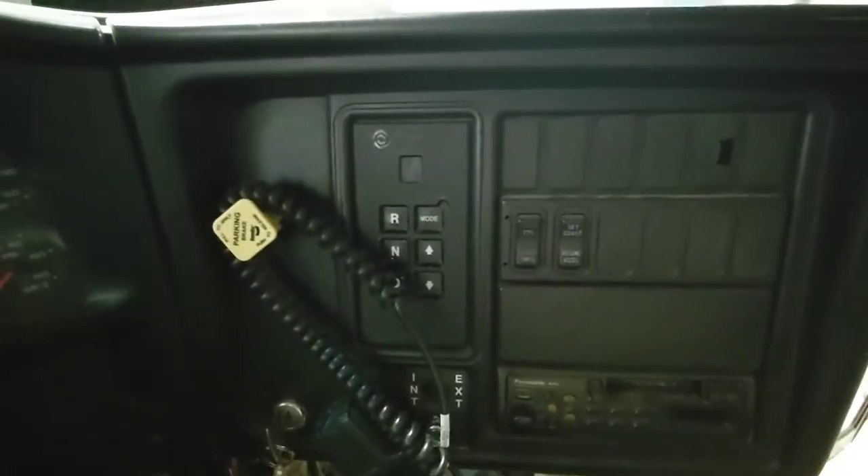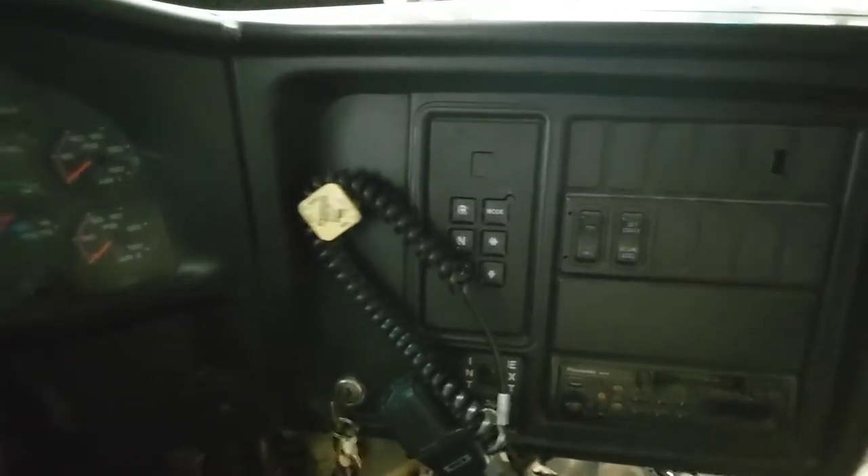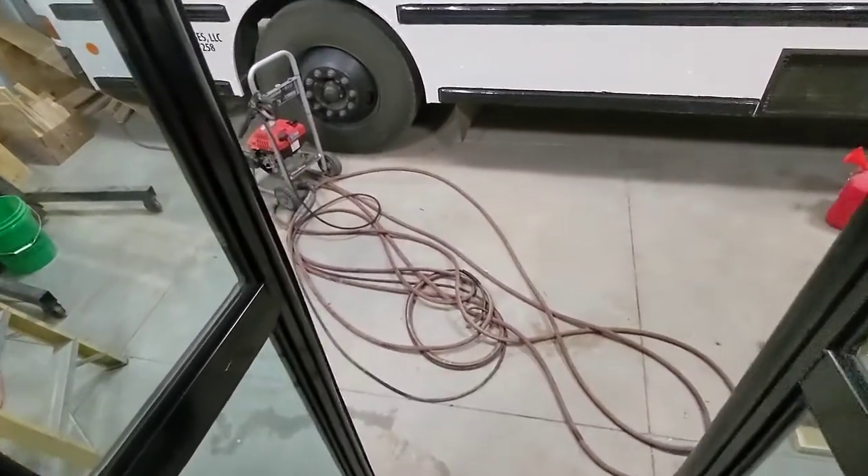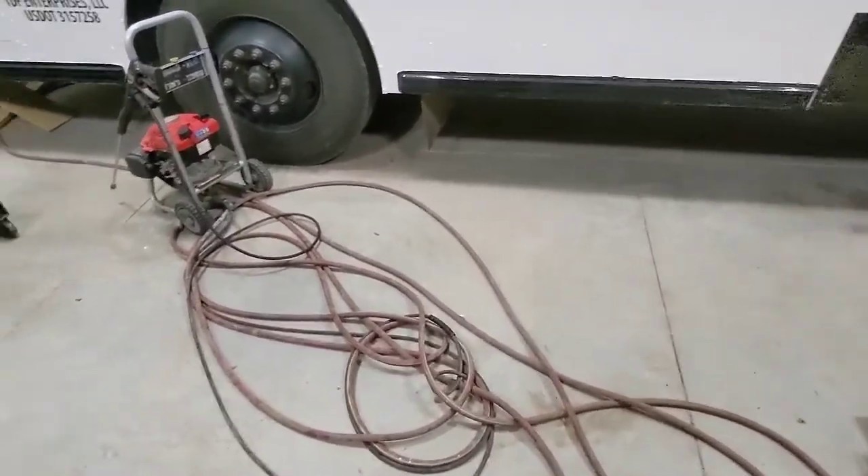We get that flashing because the engine's not running and it's not actually in gear, but that 5 indicates that the transmission is set for 5-speed, and that's the most we can do. However, this transmission is 6-speed capable, and to do that we need what's known as a TCM reflash.